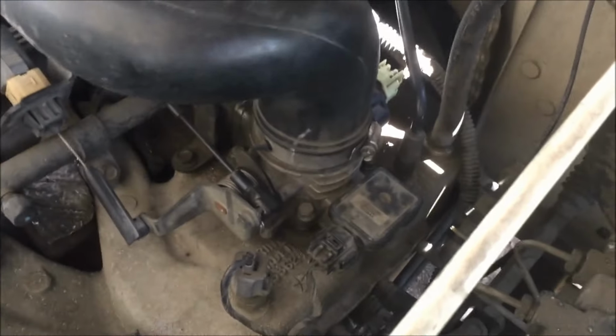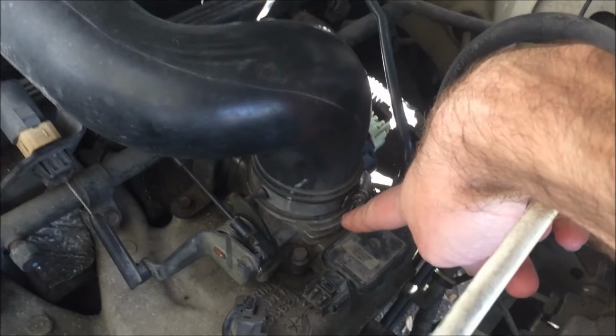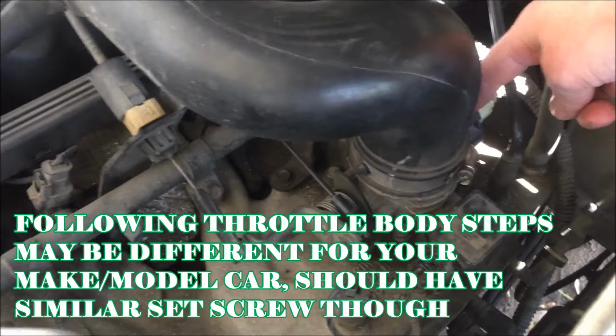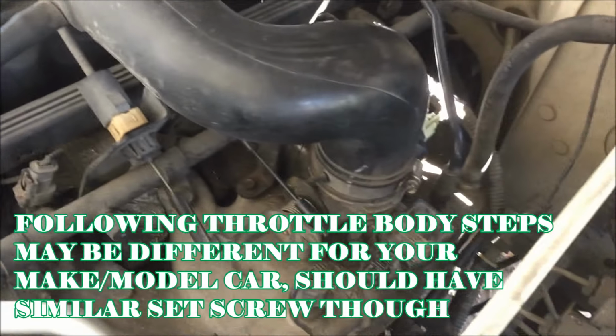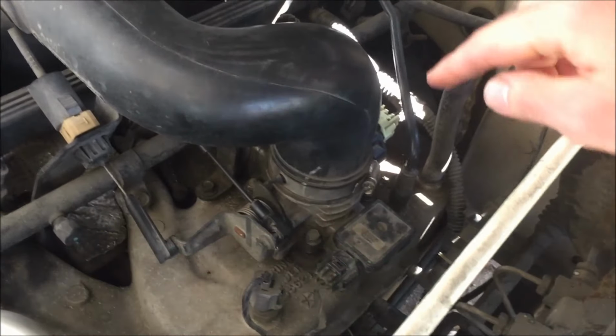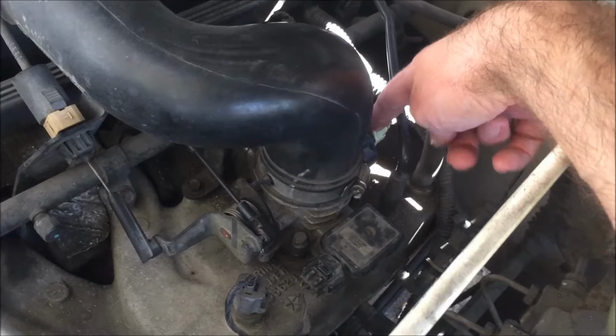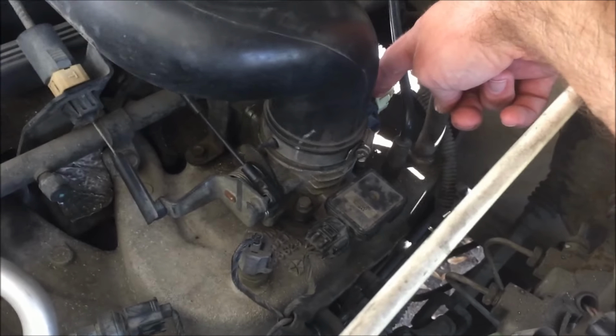To do that, this is the throttle body. I've already cleaned it and I've already replaced the idle air control valve. Those are good first starts. I put the links in the description if you want to see how to do those. After cleaning that and replacing the idle air control valve, if those don't work, then I recommend doing this step to help get that parked RPM up to 1,000.